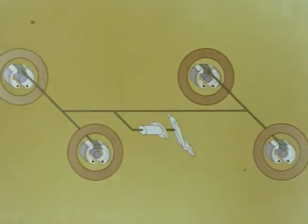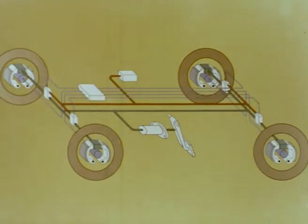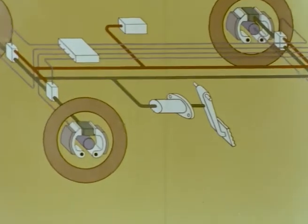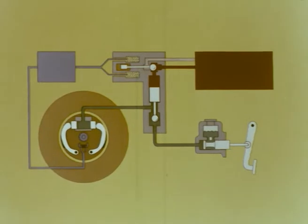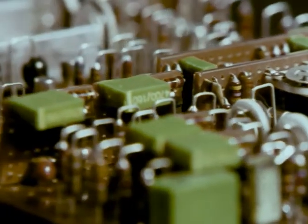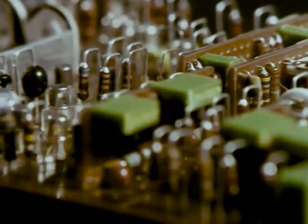We've refined this trick to perfection and, in a manner of speaking, have incorporated Hans Herrmann's lightning reactions into each of the wheels. Located between the master brake cylinder and the brake cylinders in each of the four wheels are four brake reducing valves. Sensors attached to each wheel continuously signal the wheel's values to a computer.